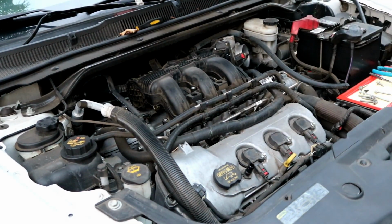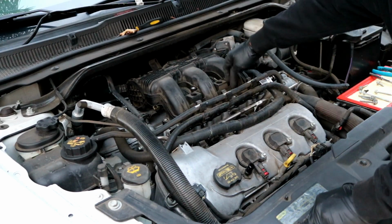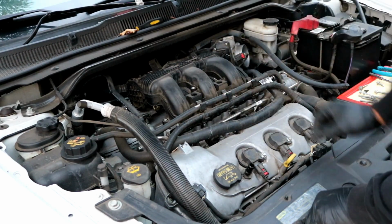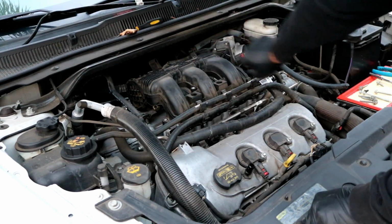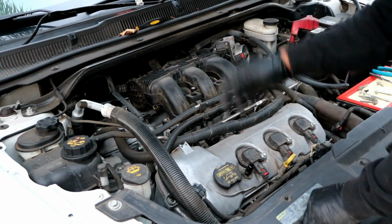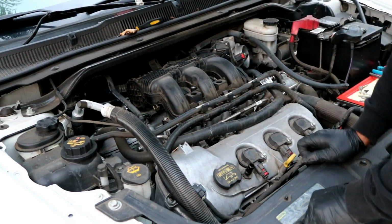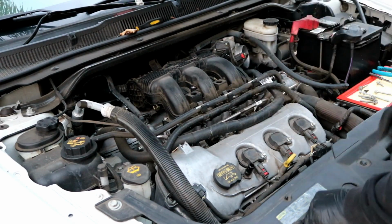Right, now after you've got that seated down, make sure that it's completely flush, and you can go on ahead and put the bolts that hold it back on. Just take them and hand tighten them in first, and make sure you get them all started on the threads, because sometimes people make the mistake of putting one in, tightening it down all the way, and then it's very difficult to get all the other bolts in. So stick them all in one by one.